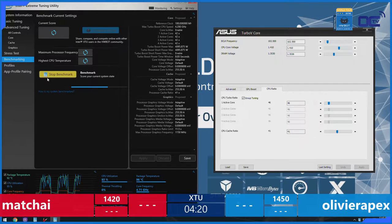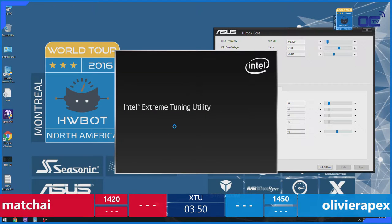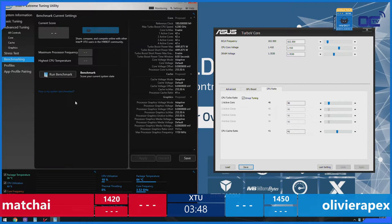And there was also a remark by Truthman about overclocking and Crysis. Indeed, it is risky because games are very dependent on stability as well. What you're seeing here is just stability memory-wise and CPU-wise. But when you're gaming, you're also throwing in the graphics card as a bundle. If you also push the graphics card a little bit higher with the software tools, the most stressful thing that can happen is you're playing a multiplayer game, in a map which lasts like 30 minutes, and five minutes from the end, you're on top of the ranking and your system just blue screens, reboots, locks up. That's difficult. You have to thoroughly test your stability when you overclock just to make sure it runs.